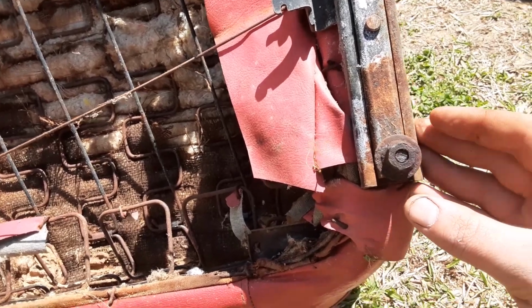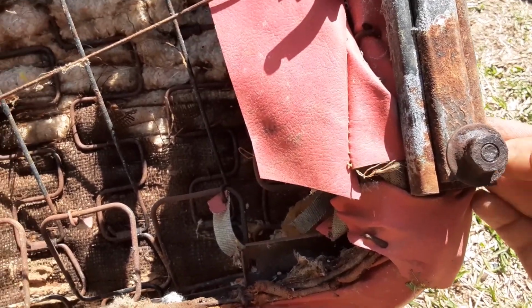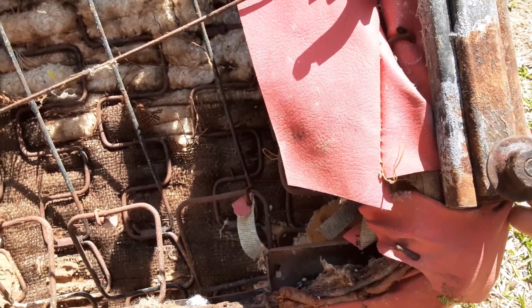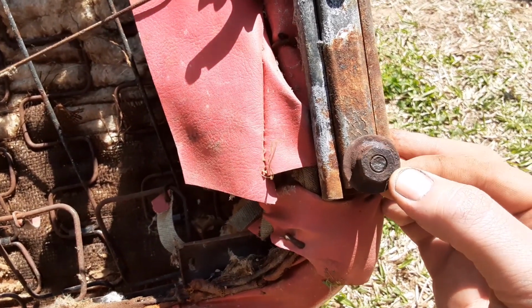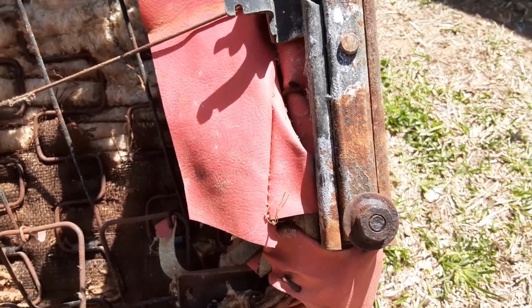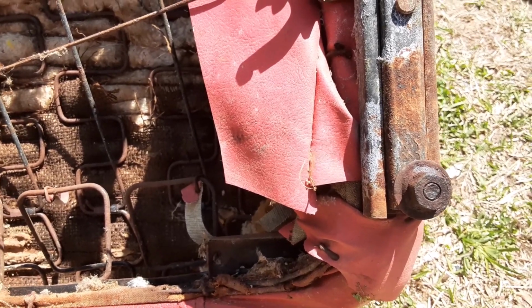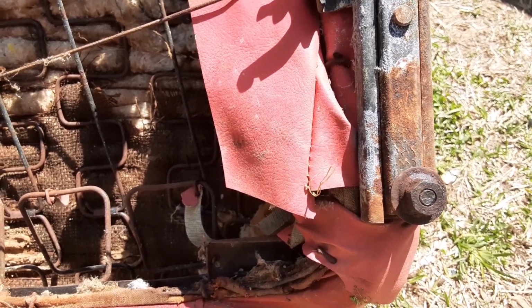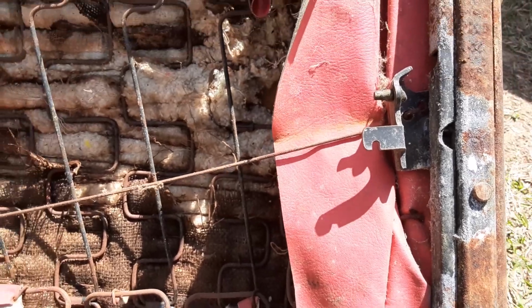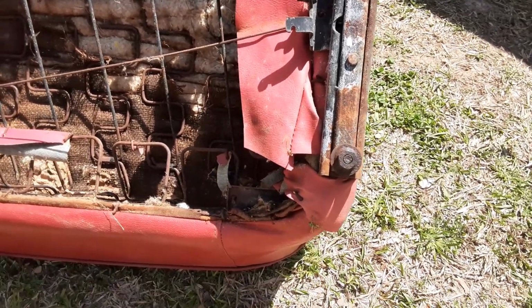When you screw it back on there, you kind of want to make it to where the stud and the end of the nut are about even. That way you protect the threads, it's less damage to the threads, and it's a little more stable, especially if you want to save these studs and use them again. I don't think you'll replace them anyways, but it's a good little practice to protect the threads.